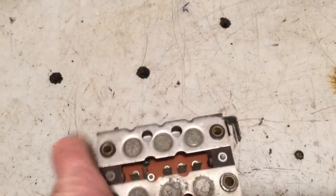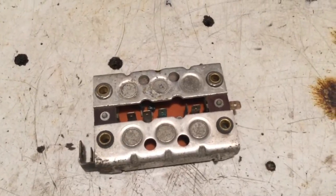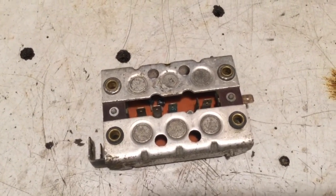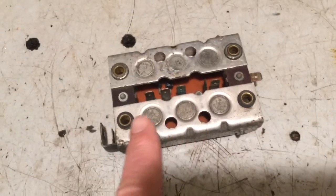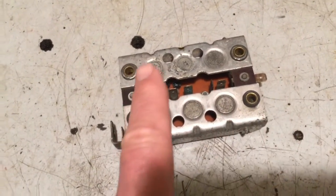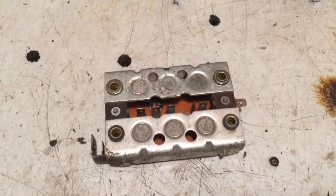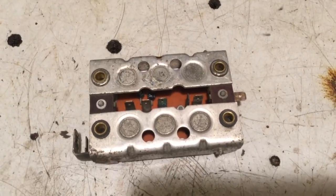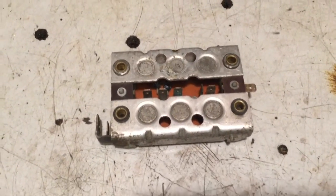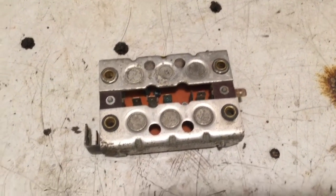What we've got here is the rectifier, and if we just turn it over you can see that on one side it's got an aluminium face with six or seven terminals showing. This aluminium face is live when it's connected up, so you need to be careful. If you've taken off the front cover of your alternator, I strongly recommend that you disconnect the battery first — if you make a short while removing the cover you may well blow some of the diodes.